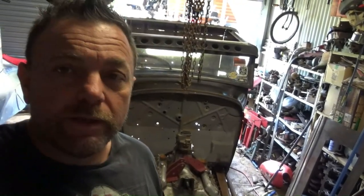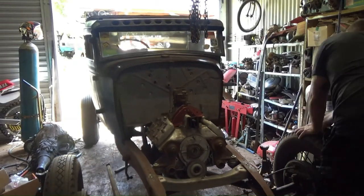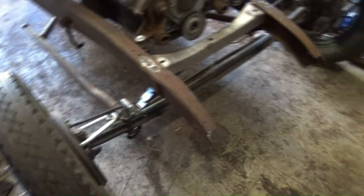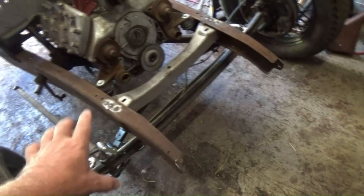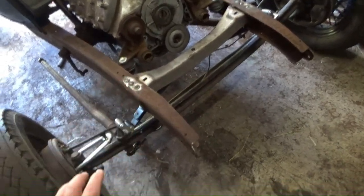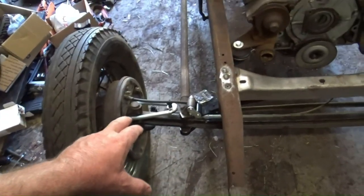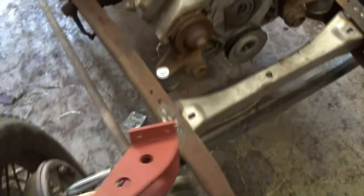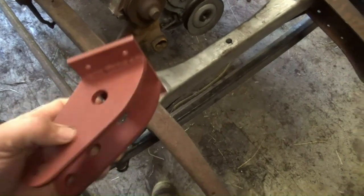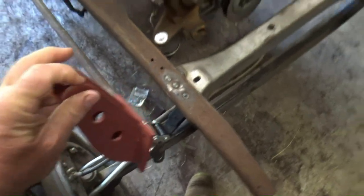It's the next day — the battery went flat yesterday, so I just kept on doing a little bit. Let's push this thing back and show where we're up to. Front spring is in; I actually put a new spare spring in which just holds it up better and clears the frame properly. Bottom shock mounts are on — well, they're just sitting there. The steering arm is pushed in there, not tightened yet — that's our cross steer, connecting to the steering box. I have some shock mounts I'm going to cut up because I don't like them — I'll cut the welds off and weld them directly to the chassis. They'll go there to hold the shocks, and I'll probably make a mount for the headlights too.